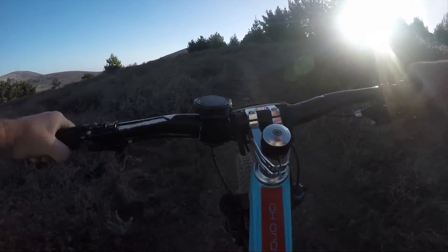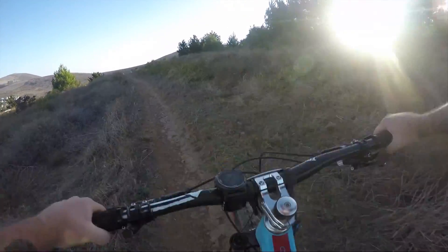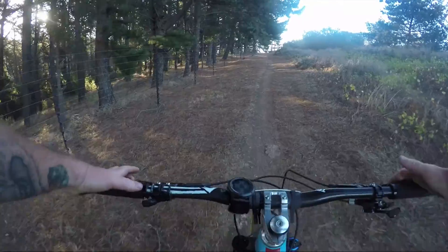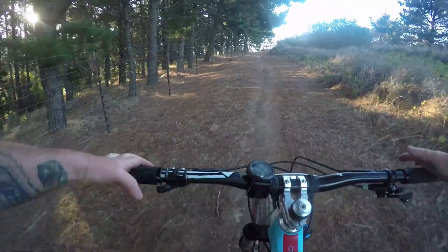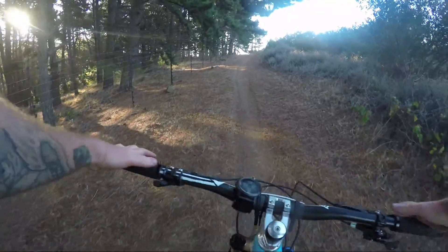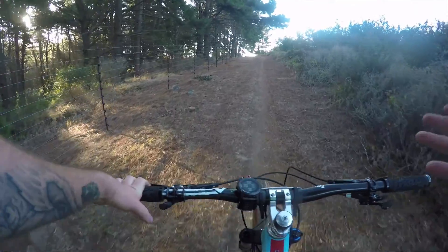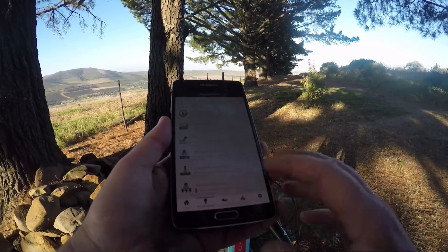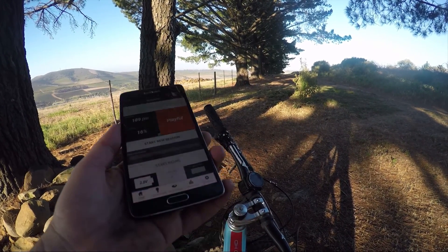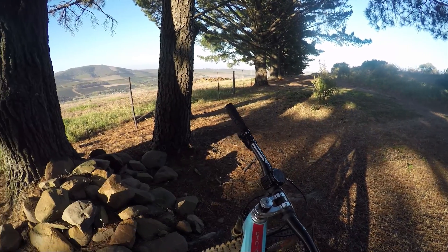I've got this on a playful tune and it's gotten me really close to what Cane Creek suggests your settings should be for this bike. What I would suggest you do is run it on a nice short loop that has a variety of different trails — so jumps, drops, rough stuff like rock gardens, G-outs, just a general trail that you would usually be riding. What I'm going to do is start a new session because I am only concerned with descending. I don't care about climbing — you've got a climb switch so you can lock that out. I just want a good downhill tune.